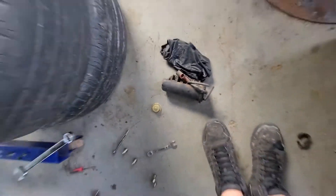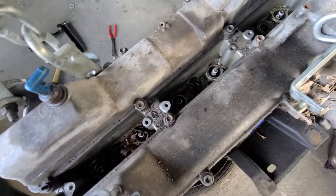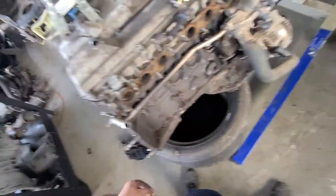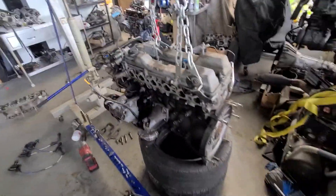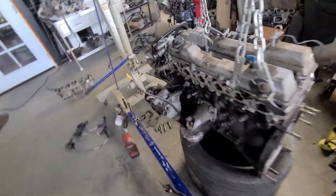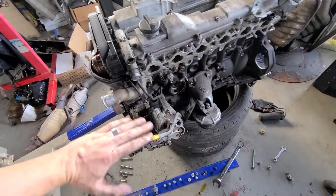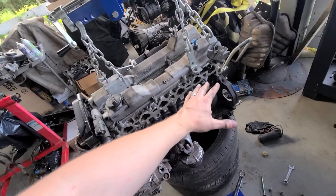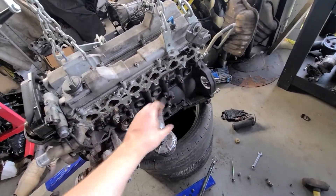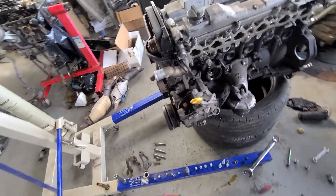Starter is removed. I've got the power steering pump, starter, engine cover, and some other bits — I think one piece is some kind of pressure valve system. There's some debris in the valley — leaves, bits of plastic. The other side of the block is becoming a lot more basic. I can now throw on the turbo manifold, which is a T4 turbo manifold that you guys haven't seen yet. I still need the intake manifold — the aftermarket one with its own runners, injectors, and throttle body rather than the factory GTE unit.